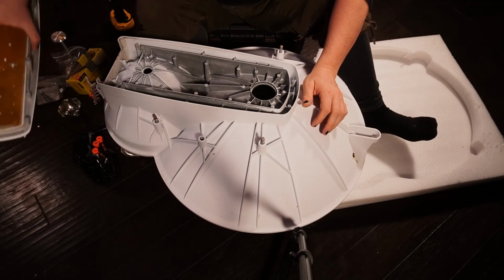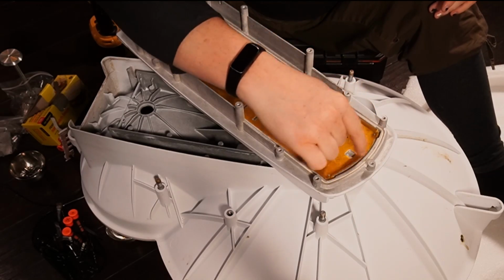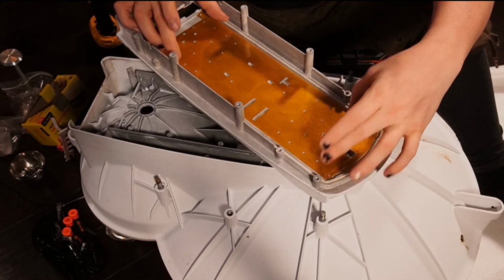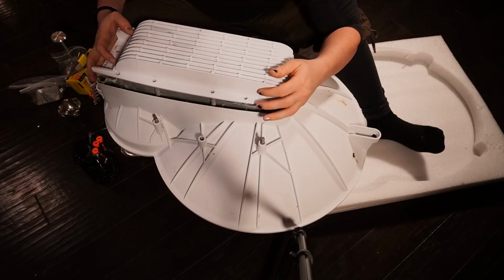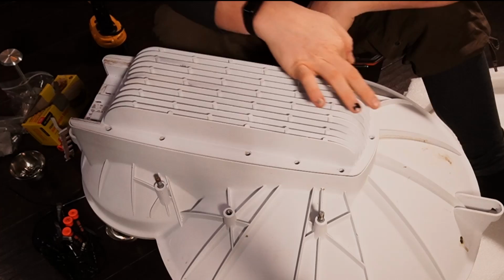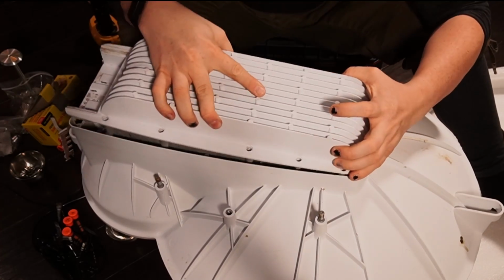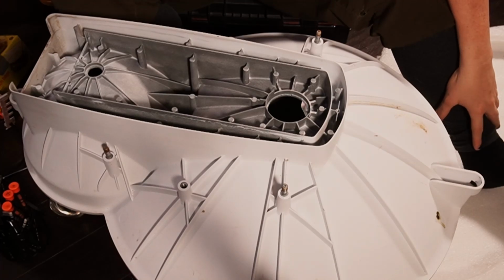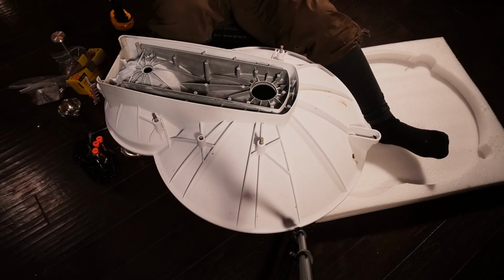That's why, if you look here, you will see that there's a gasket inside of this portion here because it's this chamber here that's watertight. When this goes together, water can still get in and around that, but it doesn't matter because the water seal is actually internal here. Isn't that cool? Okay. So that's why this thing has drains on the bottom of it.